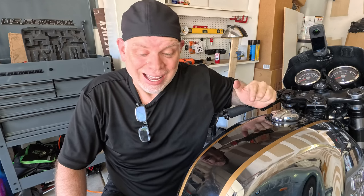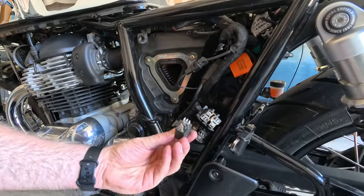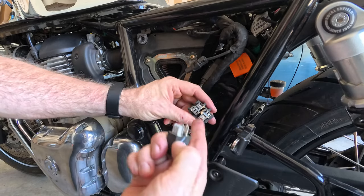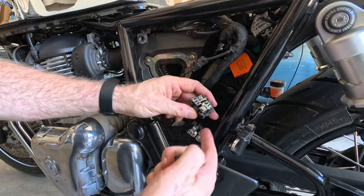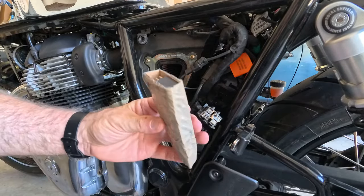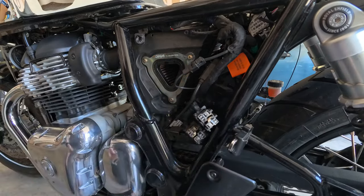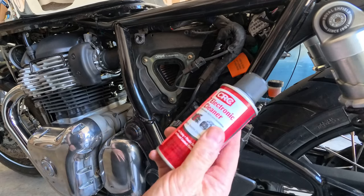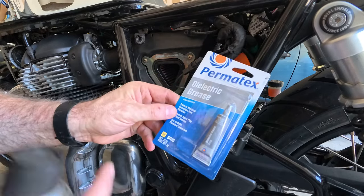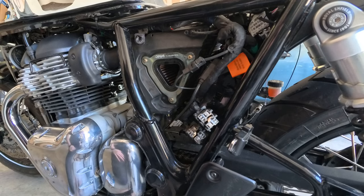If not, I think it might be the battery and I'll just have to buy a new one. I did take the relays out — they don't look bad, not corroded or anything, just kind of gummed up with grease. I have these new relays from Hitchcock Motors. I do have some electrical cleaner so I'm going to clean the connectors, and I have some grease to grease up the new ones before installing them.